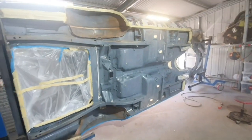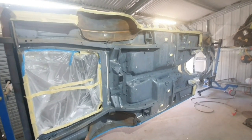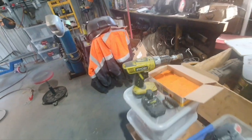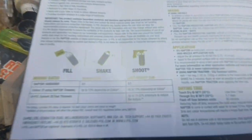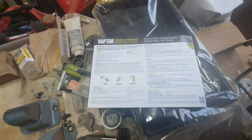I think the temperature is good, so now's the time to give this thing a coat of poly. My son's finished helping me scuff it all up — it's a shitload of work, but when you've got two hands on the job. I've got a drill with metal wool on it. Yeah, it's all scuffed up, all critical areas masked where I don't want paint on. Looking at the instructions — they want it to be at least 20 degrees, and it takes one hour between coats.